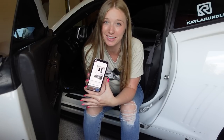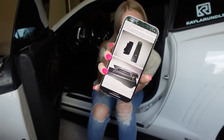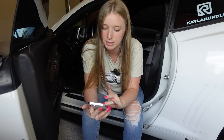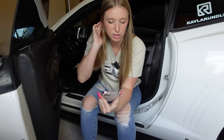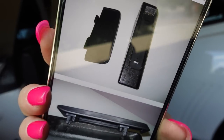The hardest part of this install is the way you have to reach all the way underneath and bend over — my body hurts. On Camaro5, which is the Camaro forum, a lot of owners recommend not removing the dead pedal or the accelerator. There is a huge foam box underneath the dead pedal and if you try to remove it, it will break all the tabs through the foam and also deform the carpet shape. So apparently you just drill right through the accelerator and dead pedal and put your new pedals on top. We don't want to break the clips that hold the pedal unit together.